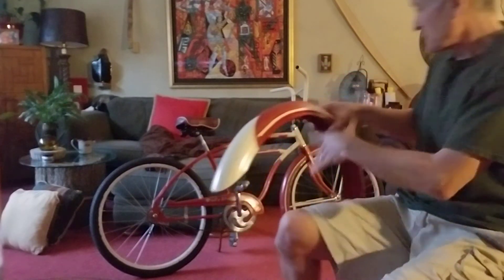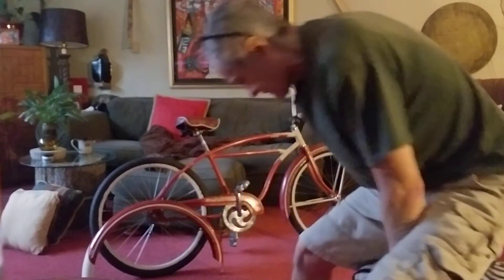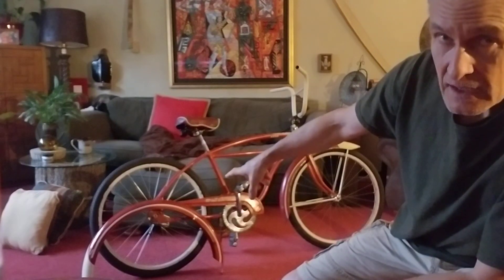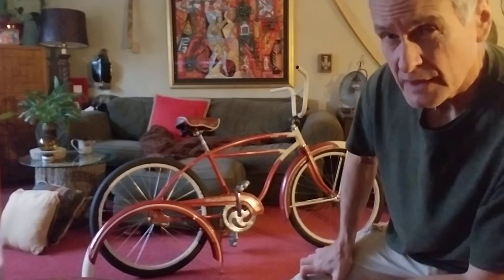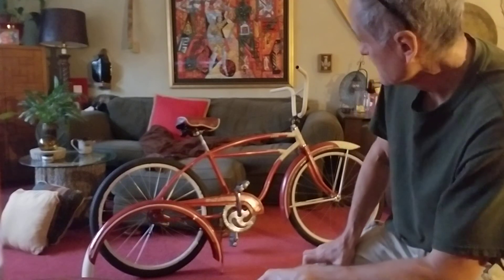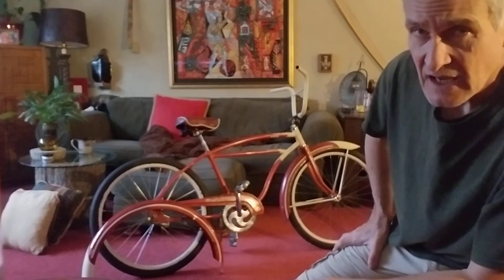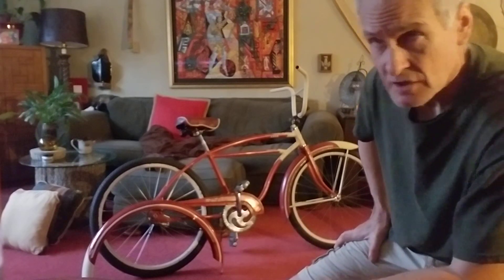That is the progress happening on this nice old bike. I still need to repack the back hub — the bearings are a little loose — and tighten everything up. With a coaster brake you need to use high-heat grease because a lot of heat is developed in that. That's my story and I'm sticking to it — the saga of this trusty little Huffy. Thank you for watching, have a good one.